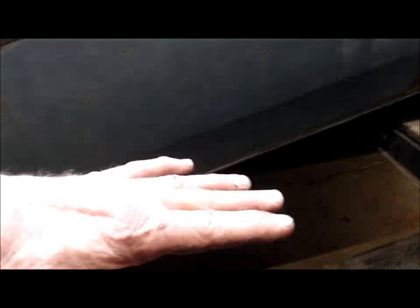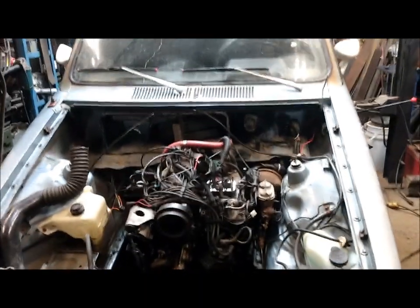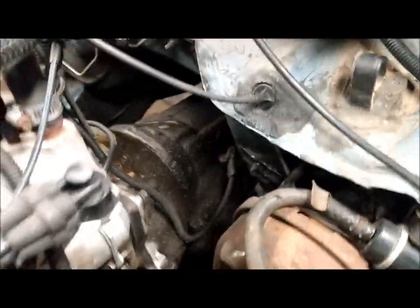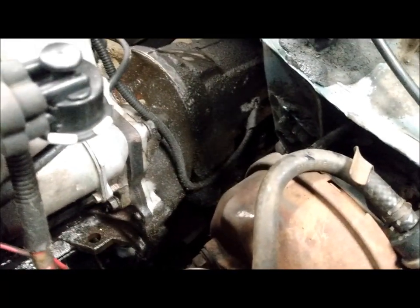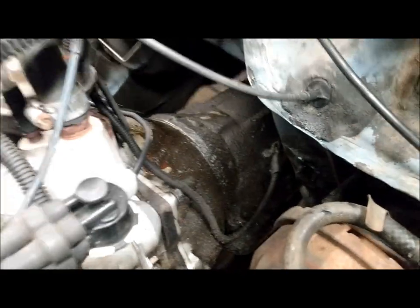I've got my car up on a four-post lift with lighting underneath. The reason I do that is so when I drop the transmission it levels off and I can get this thing out very easily — it's on a slope. I took the drive shaft off, the cross member, the speedo cable, the shifter with a 15-millimeter bolt, and the ground strap — a 10-millimeter bolt from the body side — and we got it out.